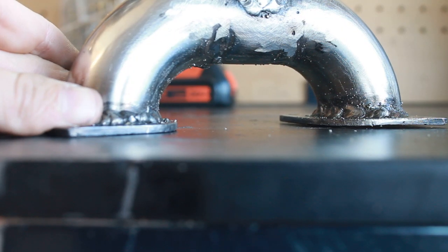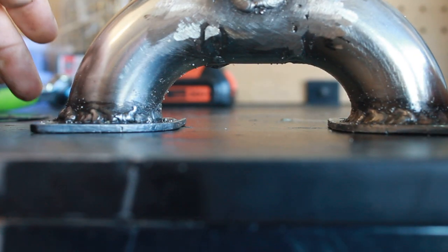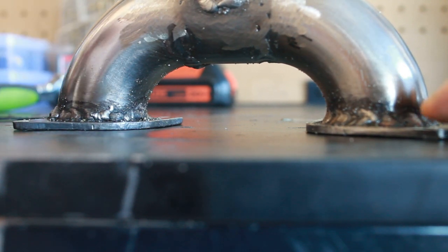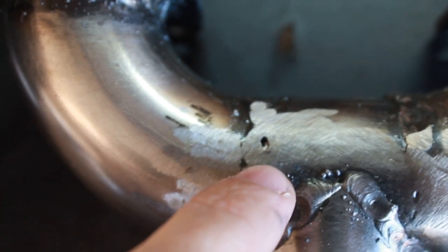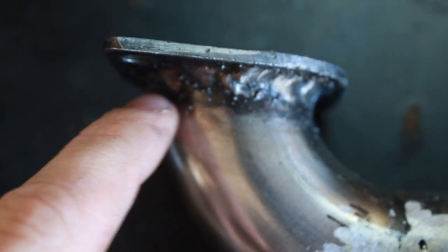If I push this down so it's flat, we've got about a sixteenth of an inch gap. We've also got a little run-out this way too, so if I tighten this side and then the other side, it's not flat. I don't think the camera can pick it up, but there's a little bit of oil residue here, which means we've got a leak. There's some there, and on the outside we've got some leaks there too. It's not flat and it has some holes in it — so we've got some major boost leaks here, boys.